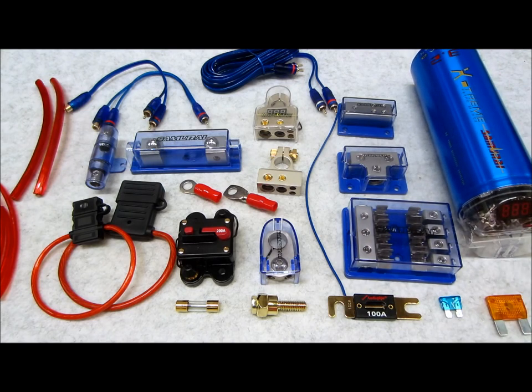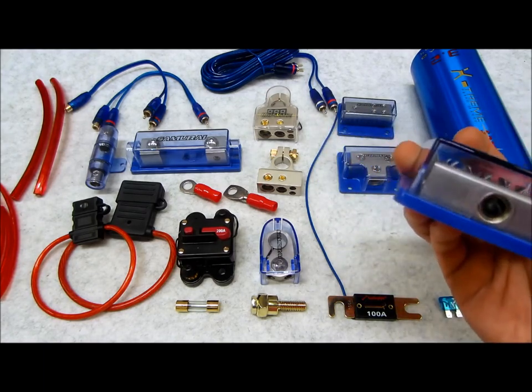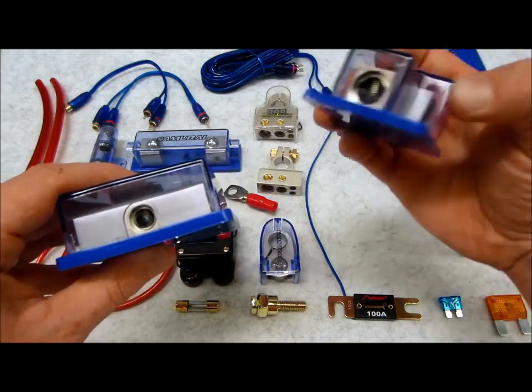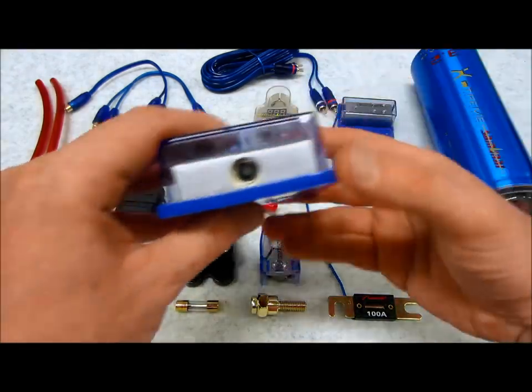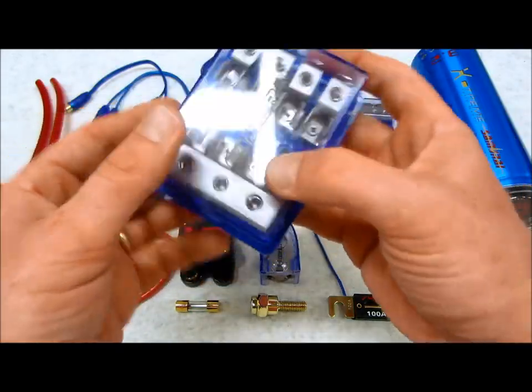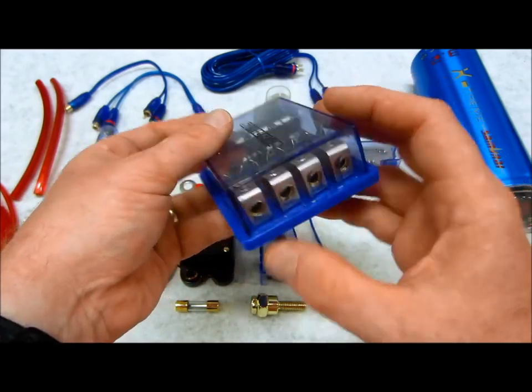I prefer to use that if I have an option, or if you're making it look nice, just for aesthetics. The capacitors are a nice choice, and they're also less expensive, and there's no need for all these extra fuses, as with a fuse distribution block, such as something like this, which accomplishes a similar type of job as this, where you have one in and 2 outputs, so it's like a T 3-way. This one here as well gives you 1 in here, 2 on the sides, which gives you a T 3-way, but you have individually fused outputs, and you can only run up to an 8 gauge leg on the output side.